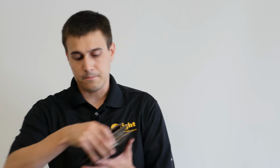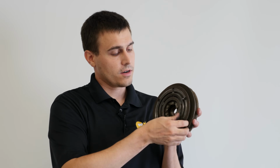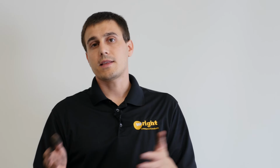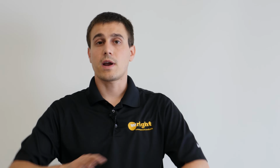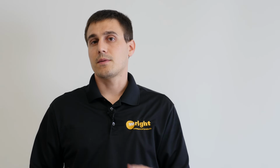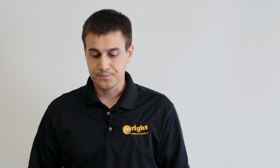You can also have issues where maybe the springs in the clutch could have cracked, and so this could be falling off, falling loose, making a lot of rattling noises, and that means your springs are broke. Any of these problems mean that you want to replace the entire clutch. You really want to make that ohm measurement, because if it fails right away, that's where you stop and put a new clutch. If it's good, then maybe there's something that can be done to salvage that clutch.